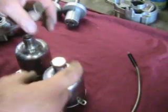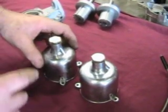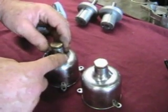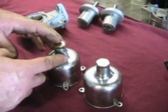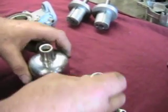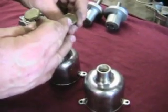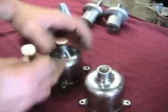The damper that has the hole goes with the suction chamber that has no hole. You have to have one hole — either in the top or in here. If you have neither, it runs too rich. If you have both, it runs really too rich. The dustless carburetors are the early 1500s, and then all the other H-type and MGB carburetors. Two different dampers: one with a hole, one without. You must have one hole — you cannot have no holes, and you cannot have two holes.